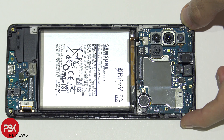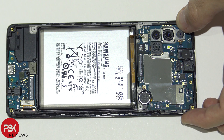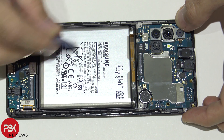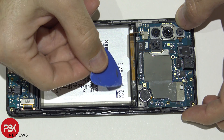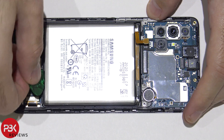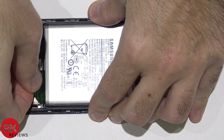As far as replacing the battery goes, there are no easy pull tabs, so you'd basically just have to heat the battery up and use a plastic pry tool to gently pry it off the mid frame. Take a membership card or something thin and flat to get underneath from the bottom or sides of the battery and gently work your way in. Don't do it from the top because you could damage the cable assembly there. I like to start with a guitar pick since it's more flexible and gets me some room so I can get my membership card placed underneath.